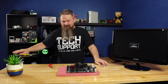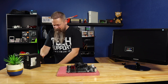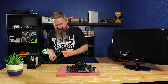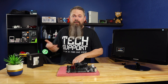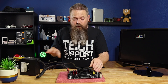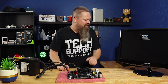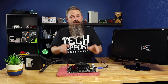Now that we have this thing ready to go, the next step is to get our power supply and plug everything in. We're only going to need two plugs from the power supply: the 24-pin and the 4-pin or 8-pin that goes to the CPU power. Mine's an 8-pin, but some motherboards come with a 4-pin CPU power connector. Whichever one yours comes with, it's going to be the same process. If your motherboard only has 4-pin CPU power, just plug in 4 of the 8 pins — the one that fits is the right one for that slot. Now plug the monitor into the monitor port and you should be good to go.